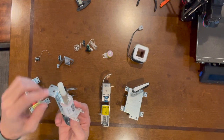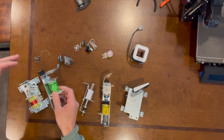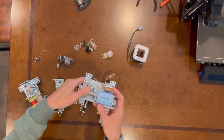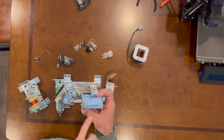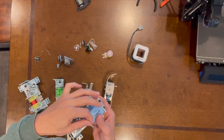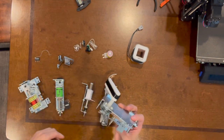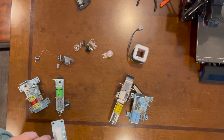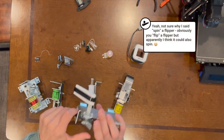So this one — 1200 — is a pretty high number because all it's doing is raising up a little plastic post to stop the ball, which doesn't need much force. To kick the ball back up on the field needs a little more, so 23-800. This Williams coil has numbers that are a little bit different. There's a chart that people have put out there that tells you what all the different numbers mean. This one is a 23-gauge 800, but it also has a 32-gauge 3000 wrapped around it — so this one supports two different power voltages. One's for the initial kick of the flipper, and the other switches over to a hold voltage which is lower, just to hold the flipper up once the ball is there.